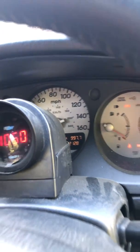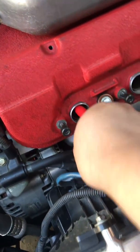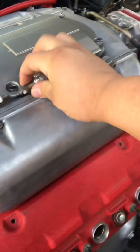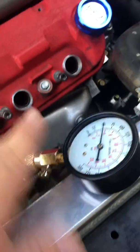It's the next day — I turned on my car and I'm letting it run for five minutes with the heater on. We drove six miles, so let's see if the compression went up. I took out my ignition coils, as you guys can see, and now I'm about to take out my spark plugs. There's a little trick to take them out without a spark plug tool. After removing all the spark plugs, we'll disconnect the fuel pump fuse. Now my compression gauge is in — make sure you tighten it well or it'll pop out. We're going to crank the car six times and see if compression went up.